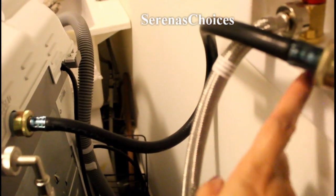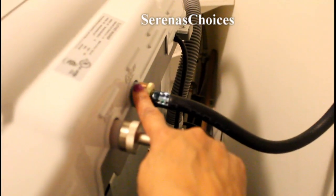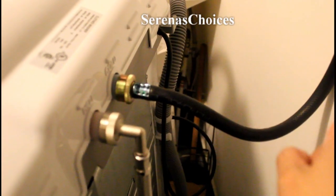put it aside to hook to the dryer, and this, if you see the black connection hose here, that's what I have here. I will connect this one to my washer. So I just connect it here. Just turn until it stops. And you know you're good. See? You turn, it stops, you know you're connected. So there I have the connection, you can see. From the wall, the main pipe, all the way here to the cold water in the washer. So that's one connection.